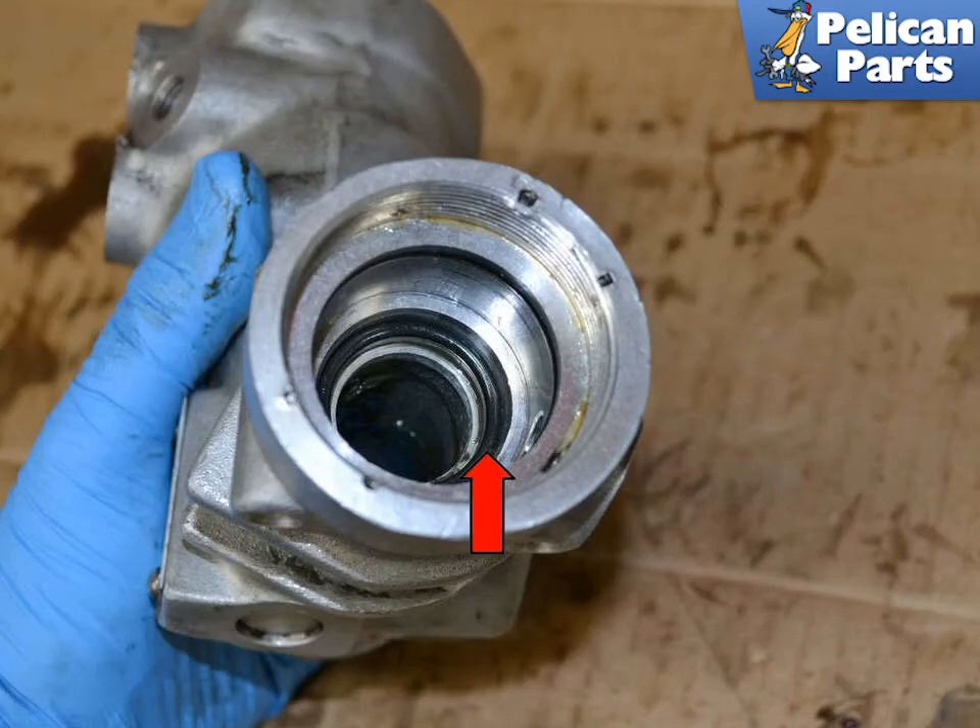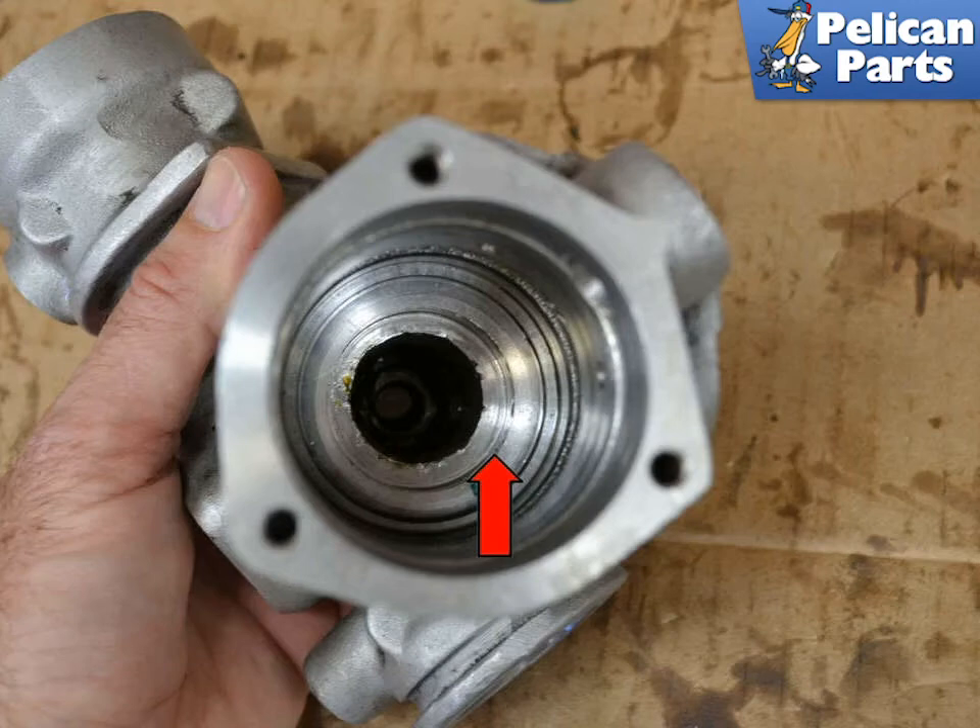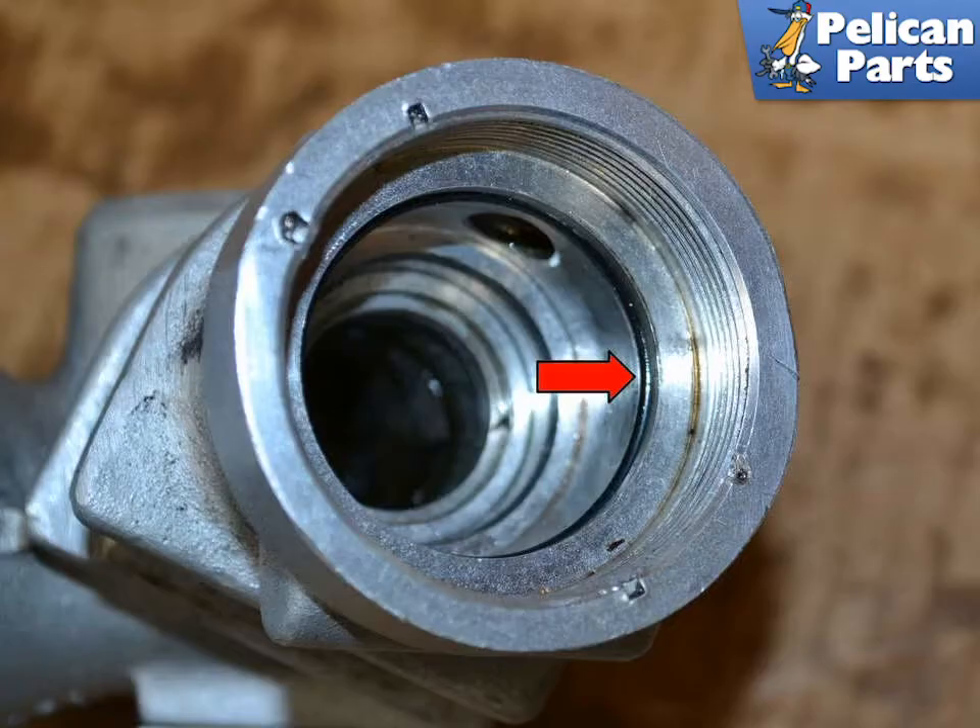There is a seal that sits in the machined recess in the housing. Removing this seal without scratching the housing can be challenging, so take your time, work cautiously, and you should only be working with plastic tools in there. With the old seal removed, insert the new seal lip side out or facing you, and push it in place using the appropriate size socket. The seal should sit just below the machined lip in the housing. Replace the o-ring from the side of the housing that faces the rack tube.